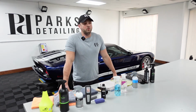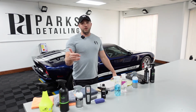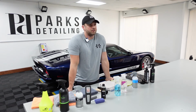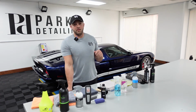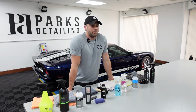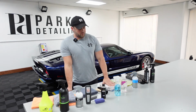So unless the customer is paying for and demanding a leather coating, then Guardian's going to be my go-to because it's kind of like H2GO. It's not going to give you the durability of Leather Shield or necessarily the performance of Leather Shield, but you can't mess it up. If you leave high spots on, even weeks later, you can get them off. A very gentle leather cleaner will get them off, so it's not stressful. And it does help a lot with jean transfer and making the leather easier to clean.